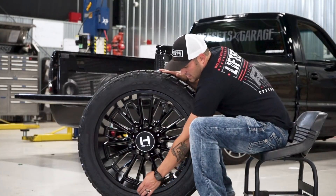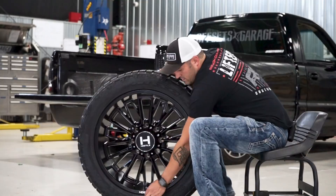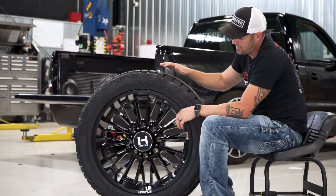And it's also not straight up and down because it's 12 1/2 wide on a 10-inch wheel. Remember, a 10-inch wheel out to the edge of the bead is actually 11 inches. So that's why you're seeing about three quarters of an inch of sidewall bulge all the way around, coming out to protect the side of that wheel a little bit.